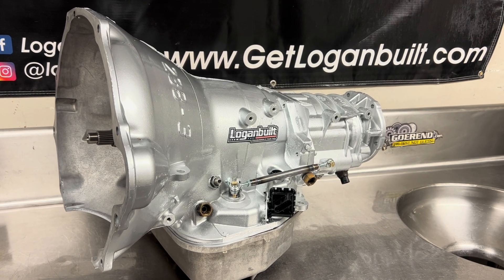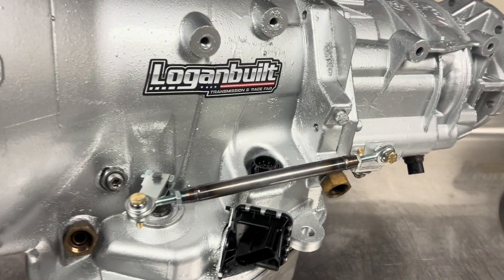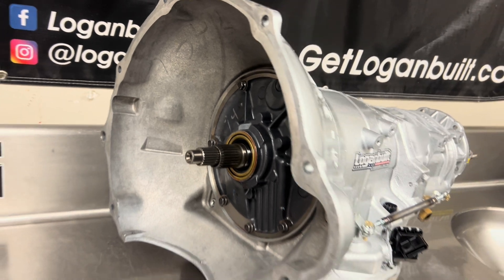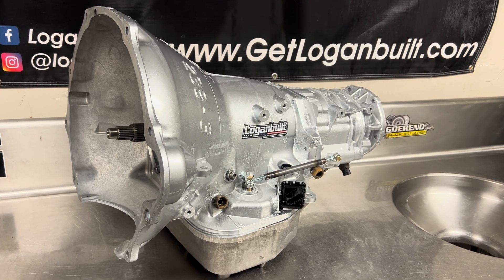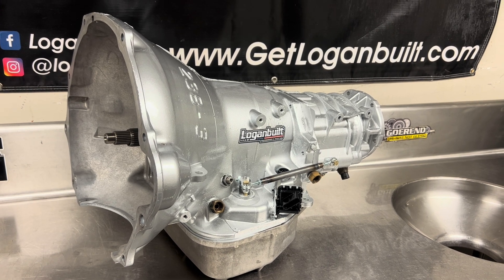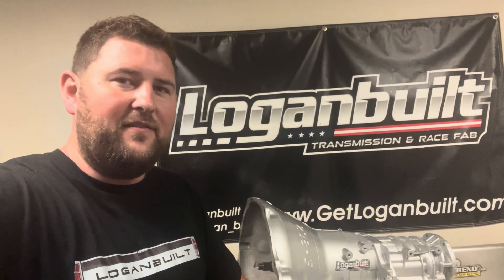We are all back together now, painted up in the silver the customer requested. I think I'll call this one the 'Tin Man' because we did a manual valve body — it needed one of my TV adjuster kits, so I've added one of those. Also cleaned up where that pesky oil leak was. All my parts go through a parts washer, so everything — regardless of whether it's new, used, or a refresh — gets nice and clean with a brand new finish. This one's all done and ready to go back to the customer. That's going to do it for this episode of Fix It Again — drop a comment, subscribe to the channel, and thanks for watching!